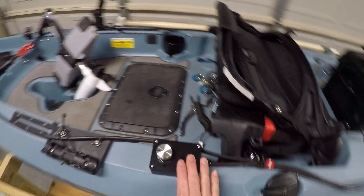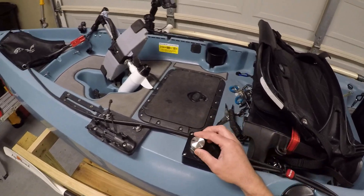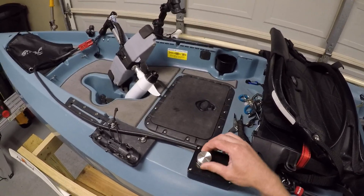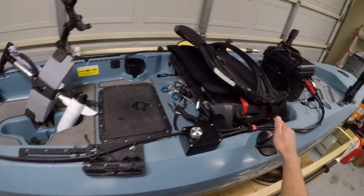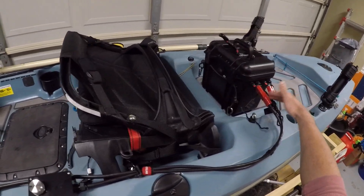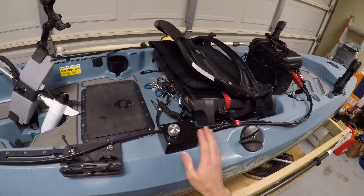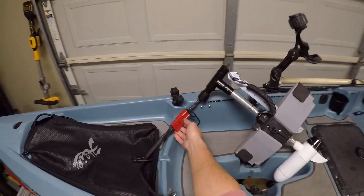You've got two lines coming from the battery box. One is to the PWM control unit. This is the knob right here — it goes forward, then stops, and then goes reverse. The cable from the PWM routes the same way as the control box and the potentiometer knob, and it goes up the kayak straight to the motor.